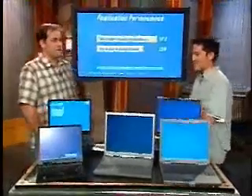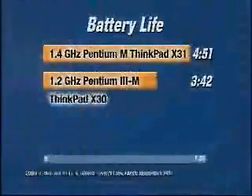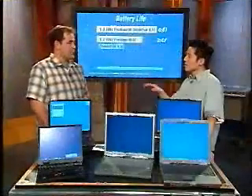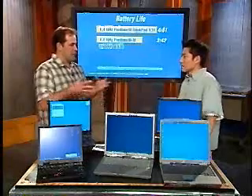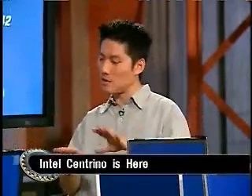The battery life results are the killer stat. We looked at a ThinkPad X31 versus the previous X30 — and this is actually one of the lower increases — a 30% increase in battery life, from 3 hours 42 minutes up to 4 hours 51 minutes. Typically they saw anywhere from a one- to three-hour increase in battery life across notebook models. On bigger models, they added bigger batteries too, so we're getting almost 7 hours in some notebooks. The IBM ThinkPad T30 versus the T40 went from 18 watts of power consumption down to 10 watts — about an 8-watt savings.